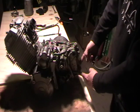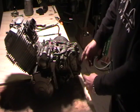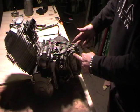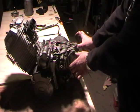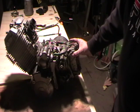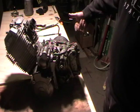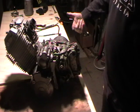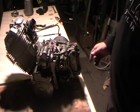We have a bolt that fits through the bottom, a mounting bolt. That goes onto the frame. The top one is onto your swinging arm bolt. The swinging arm bolt actually goes through with the roller bearings either side. The easiest way I've found to do it is to use another bolt or spindle or something similar size to push in from the right hand side, so you can push the spindle out. It actually leaves the swinging arm in place. It saves it all collapsing.